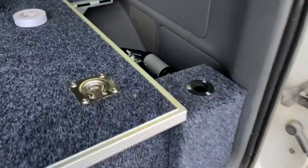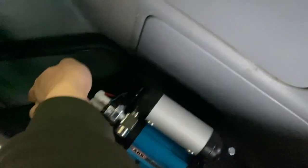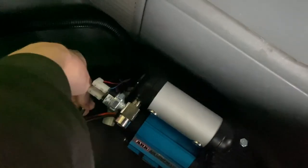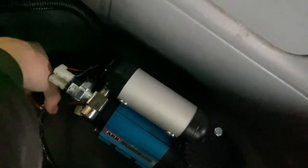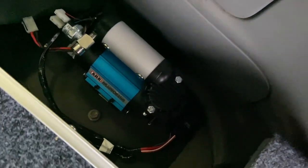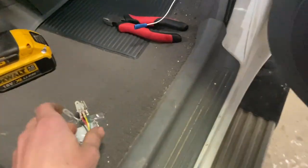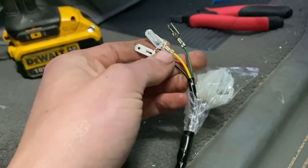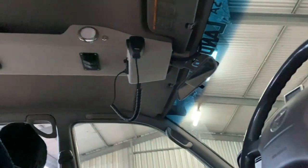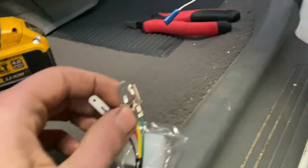All right guys, so here is the verdict. I've got the air compressor in here mounted, I've got the positive and negative run back, I've got the pressure switch on, and I just have to connect the power to the motor after I put the battery terminals on. Got our relay mounted down there. I've run the switch wire just temporarily because I want to test that this works first. They've given us wires for a complete switch, but I've already got one wired in up in the roof console, so all I want is the sense wire coming down from there — that goes to that red one there. We're just going to test that and make sure it's okay before we cover it all up.